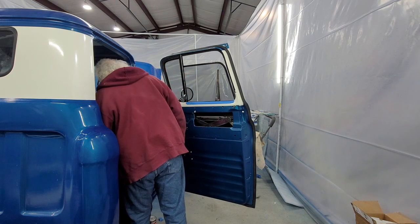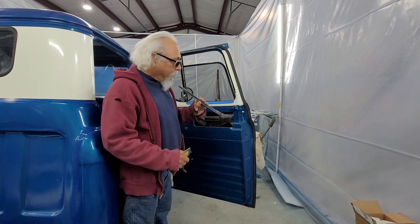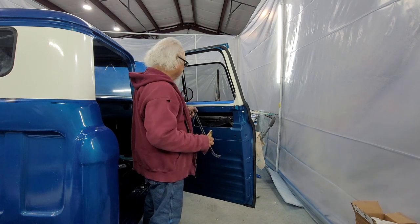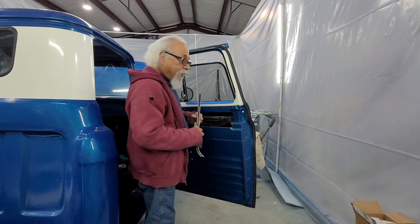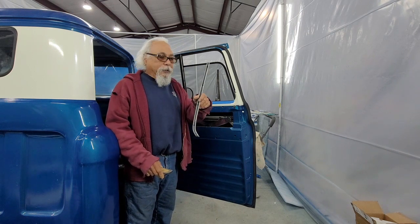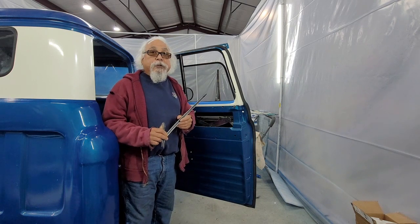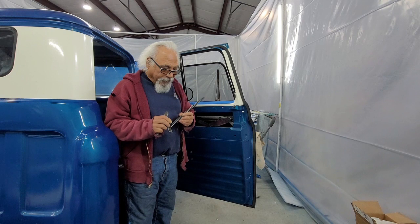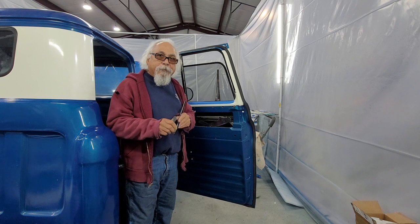And remember I told you about this in the beginning of the video? This is where this piece goes in here, right? And the problem is it's a real tight fit. The reason why I said check your spacing if you buy the $40 version: the spacings are supposed to be 5-inch centers. Mine was 5 1/8. These clips don't move 1/8, right? I tried moving them. They're really tight in there. It's got a channel that they snap in, so there's not a lot of movement, right?